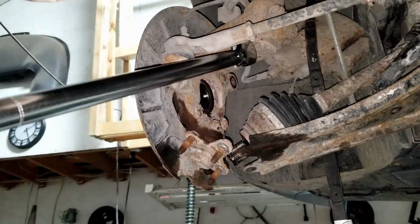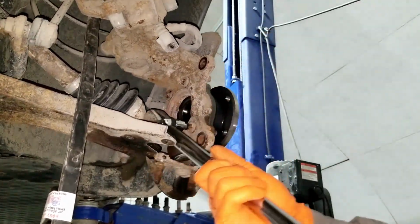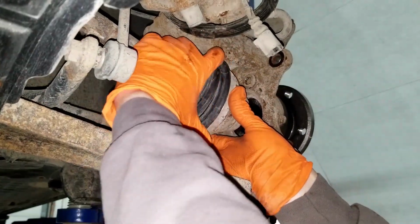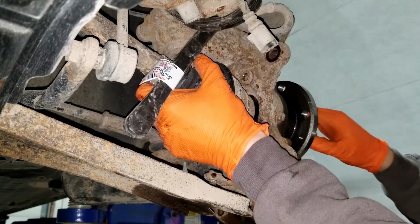By the way, I will also include all the torque specs in the description for you, with the tools you'll need for the job. Once the hub assembly is installed and torqued, get the axle started into the hub and start the bolt so the axle won't slip out again.